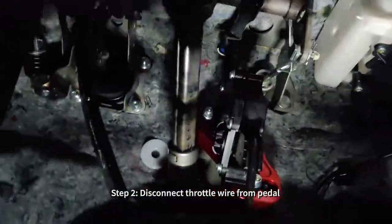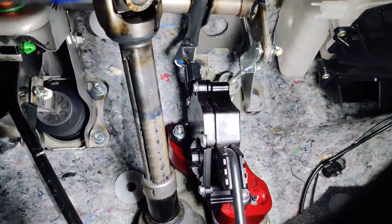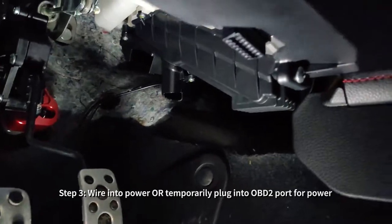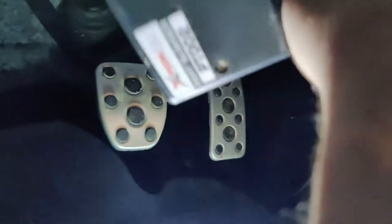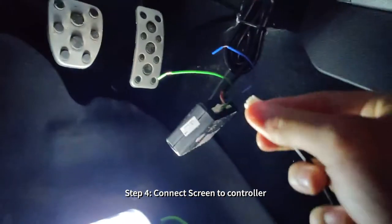My battery's been disconnected for well over 10 minutes. Now we're just going to disconnect this wire at the top — where that actually plugs in, kind of in the center of my screen there, you're just going to disconnect that wire. It's a simple pop, just grab it and it should pop right off. So once that wire's off, I'm going to do the easy way using this OBD adapter here. I'll hardwire it in more if this is a good device, but for now just find your OBD and plug it in. Make sure it's nice and firm in there, you're not crushing any of the wires, and we'll cable manage this in a bit.